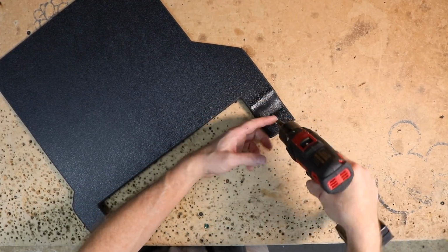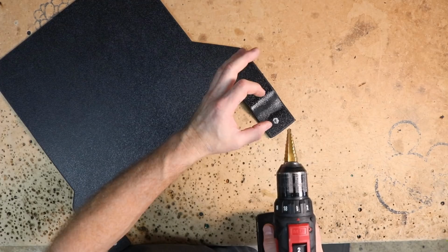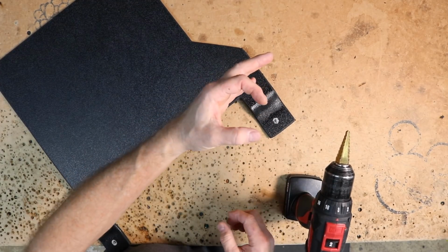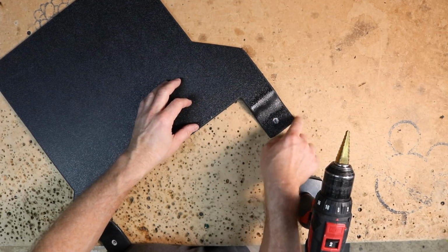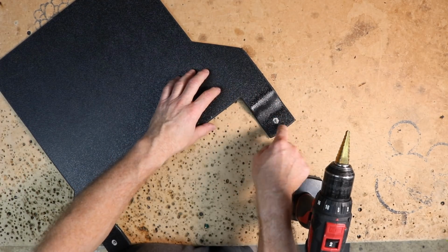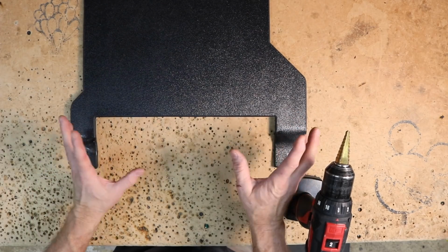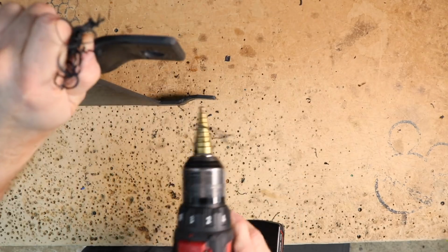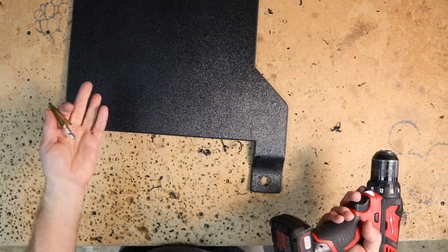When drilling your seat bolts into the ABS like that, a step bit works great. Make sure you go a little bigger than you feel you might need. The seats have like washers welded to the bottom of them as spacers. If they do, that's great because you can get a hole that's big enough. The washers will go through our hole. Also, you want to be able to just line this up perfectly, so if the holes are a little big, it's okay. As you saw there, I like to go through both sides, not just one. It just makes for a better hole.